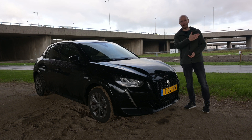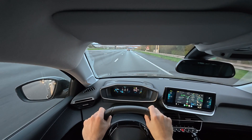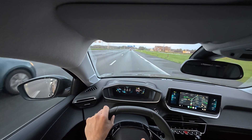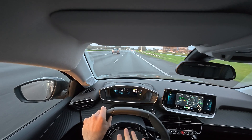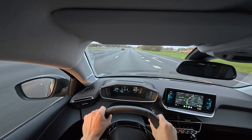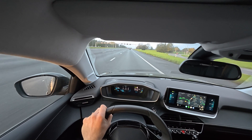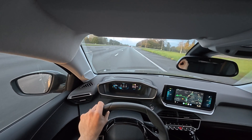So let's get in the car and drive. I have been driving for around an hour now doing my degradation test. How do I do my degradation test? It is actually very simple: I charge the car to 100%, then drive at 90 kilometers per hour GPS speed all the way to zero — or close to zero. Then based on the consumption and the distance I have driven, I can calculate how much energy I could get out of the battery. I drive 90 kilometers per hour to reduce heat loss, because the faster you drive, the more heat loss you have in the drivetrain and you get less energy out of the battery. Driving 90 kilometers per hour, I have less heat loss, so I can get closer to the lab result that the manufacturer claims the car had when it was new.